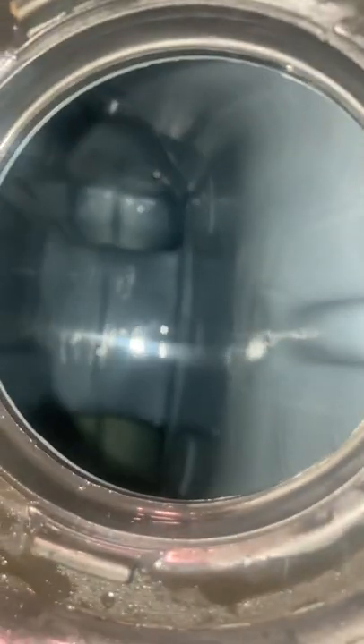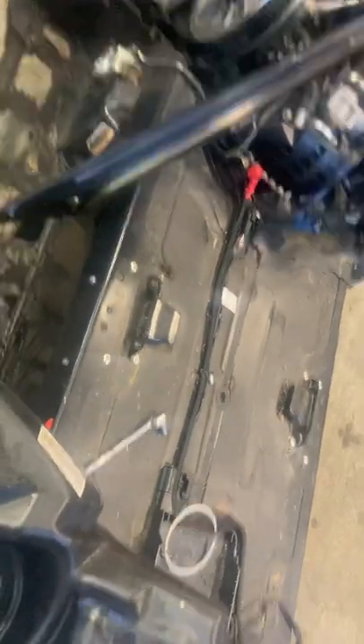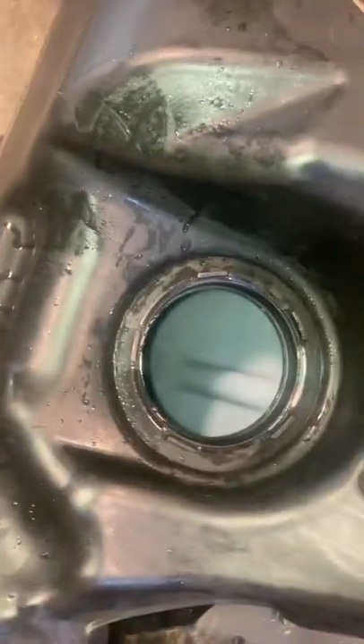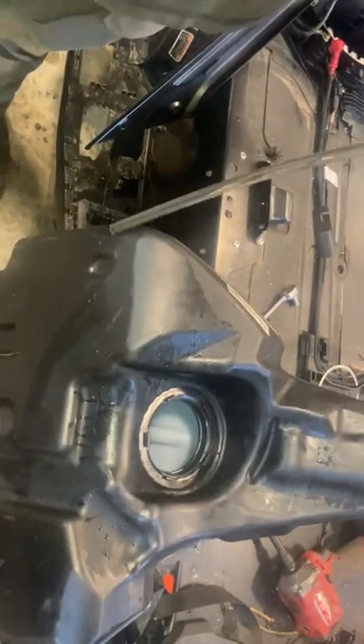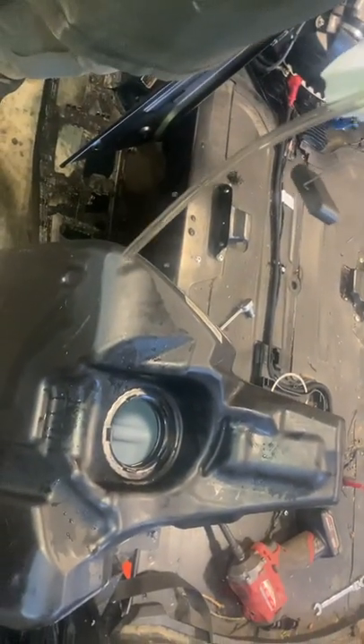I don't know how this is going to show up, but there is absolutely nothing in this tank. We have flushed this tank the first time about 700 miles ago on that last tank filter deal, and we never changed the filter. So in all honesty, I don't see anything inside this tank that's coming apart now. I'm going to set it aside and we're going to start taking apart the fuel pump. My belief is that these things are getting full of stuff from the factory, whether they're drilling, milling, or whatever they're doing to put in their fittings, and they're not getting cleaned out. My alternative theory is that they're being stored wide open with these big holes for a long period of time and they're getting junk in them, and Ski-Doo's not cleaning them out. There is definitely a case to be made that there's a problem because too many people are having problems with these filters.